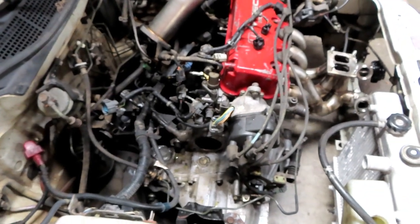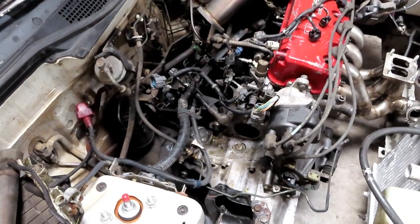I'll go ahead and show you guys real fast what we have going on, and the reason it wasn't in this video, why we went over and worked on the EF instead. When you put the twin disc in, we have found, hey, Bryan, can you turn the crank for me real fast? Yes. All right, I'm gonna have Bryan turn the crank so you guys can see what the problem is when you do put the twin disc in. You obviously gotta modify the transmission. Somewhere inside there's gonna be something that we're gonna have to grind out of the way. Hopefully it's nothing major, but I'll have him move the crank just so you guys can see what the issue is. We're glad we noticed it now instead of trying to start it and having it hit the starter and totally mess up the flywheel.